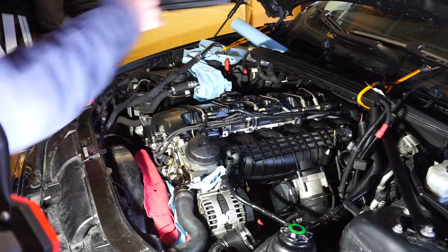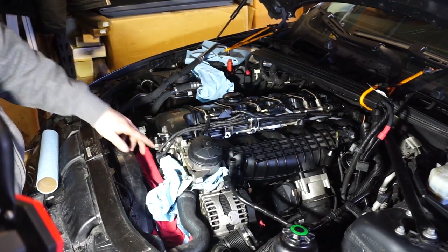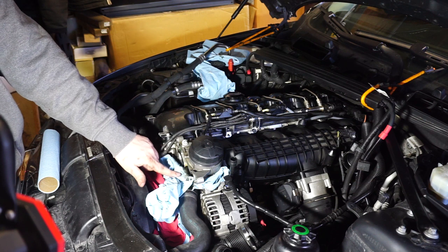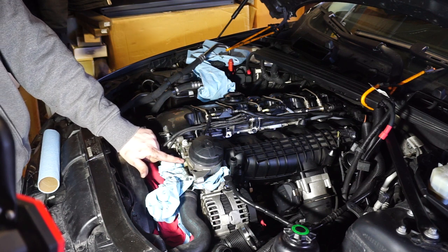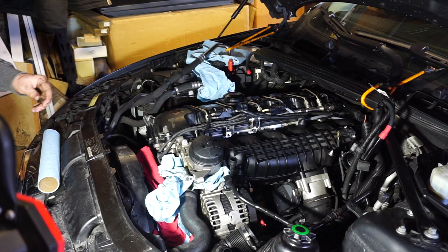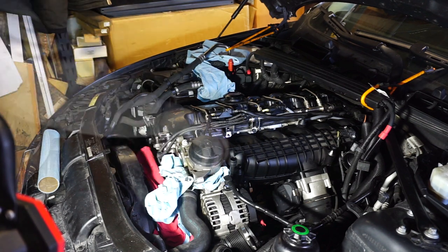In this wire here, and I couldn't. Yeah, so right there, guys, you can see where the oil and the coolant, you know, they're just separated by the gasket, so you can easily get a little bit of mixture here if this gasket goes bad, and you'll get condensation and stuff building up in your motor. No bueno. No bueno.